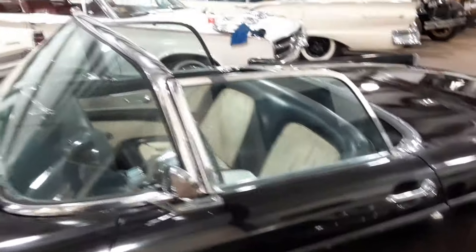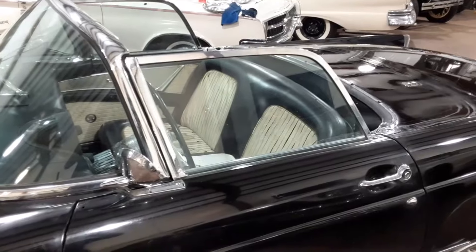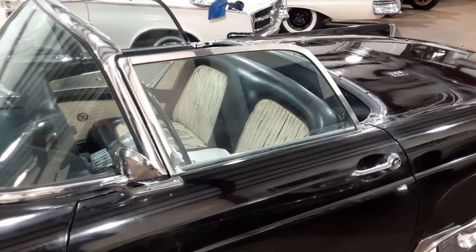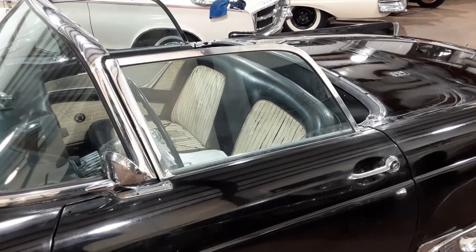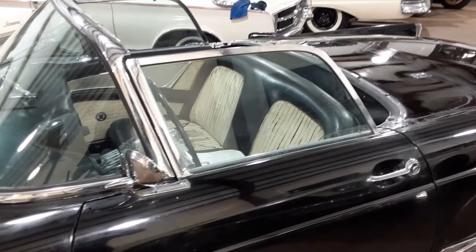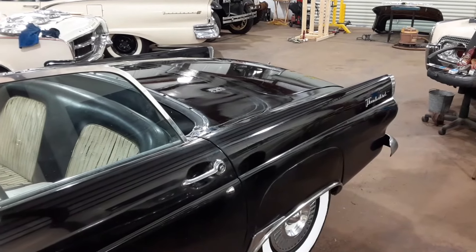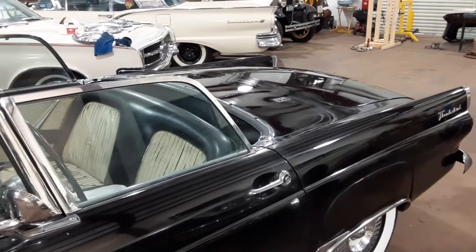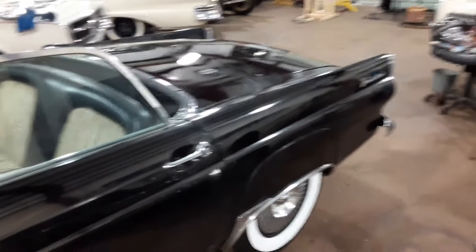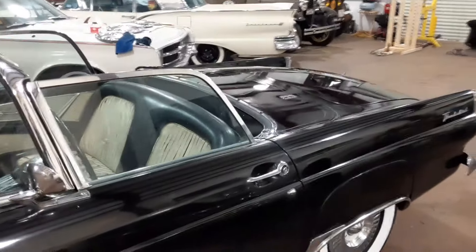That window is working good and the other one should work good too. The next power thing I'll mess with will be the seat — it's quite dirty underneath, so it'll be interesting to get it out. I've already rebuilt the vertical screw jack and gearbox, but the forward-and-backward mechanism underneath the seat hasn't been rebuilt yet, and the tracks still need to be cleaned and greased. The paint looks good in the back, and I also did the hood, though it probably needs a third round of compounding to look as good as the rear. That's it for today.